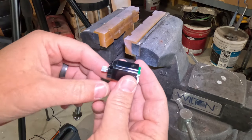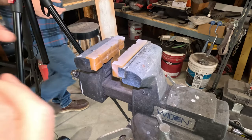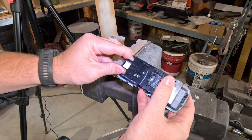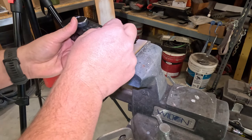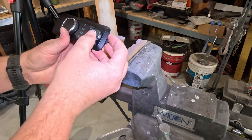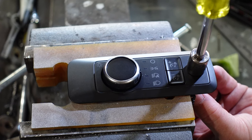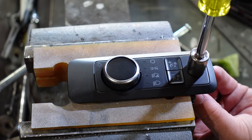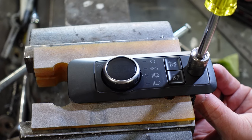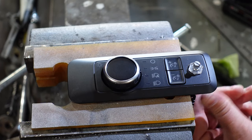Here's our little control knob that we're going to put on the backside — we just want to remember that this side is up, and you can see what that looks like on the backside. So again, we're going to line everything up in the back here, make sure that we've got it aligned and centered. Twist our knob all the way to the left so our zero lines right up at the top. And so there we have it. We're just going to tighten this up very slowly because everything is plastic. You want it to bite on the backside because you don't want this twisting as you try to twist that knob.